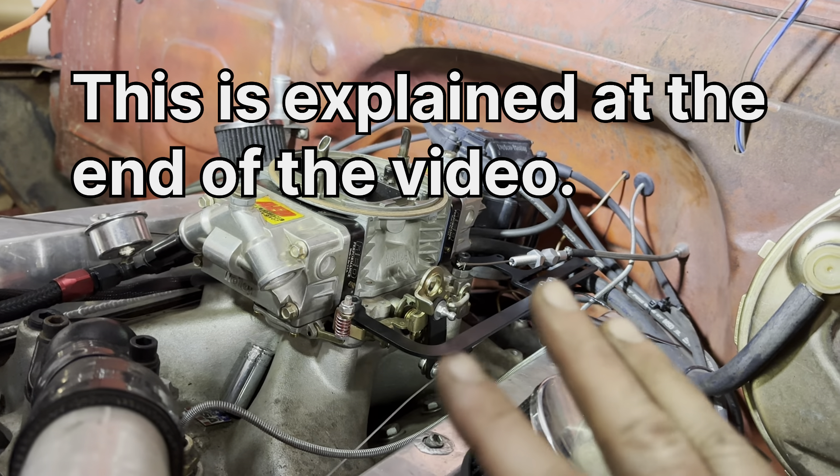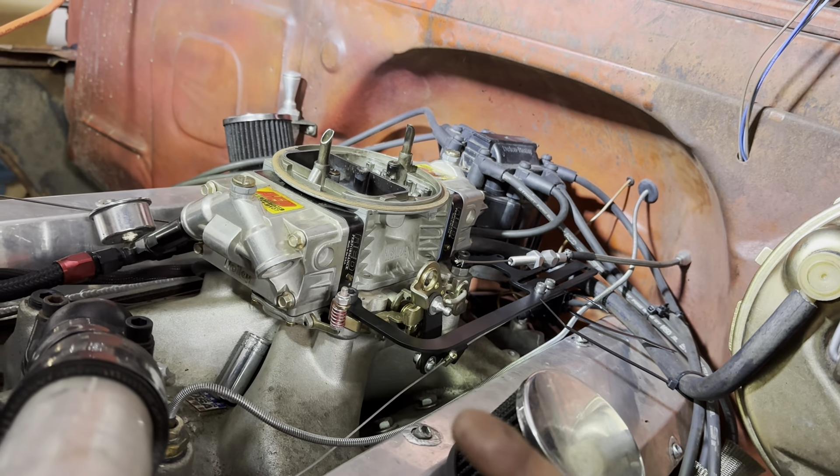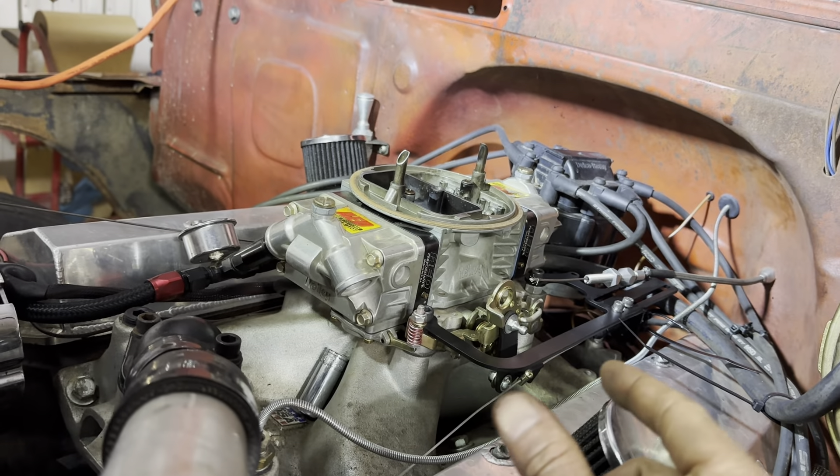Brent is under here doing the work on my valve body. We're probably going to drill a different hole in there. We had to modify the TV cable bracket to get the stroke and everything right. He made a little template off our old one — it was way out here — and we want the nub where the TV cable connects to be right here. That's why we've notched it down, and I'm going to attempt to get the TIG welder out and weld that up.